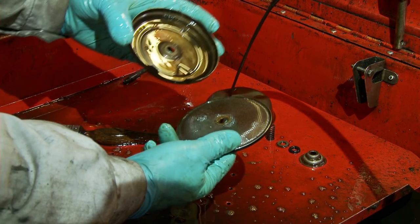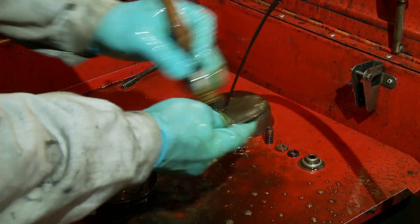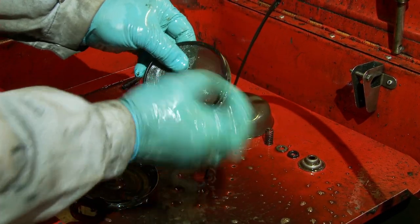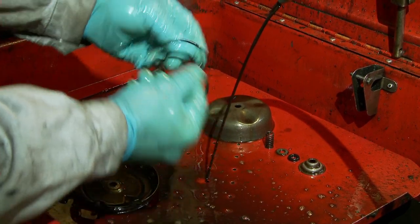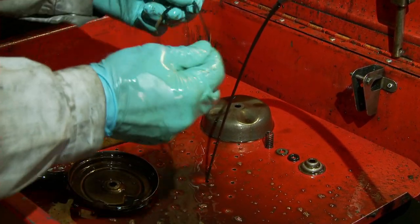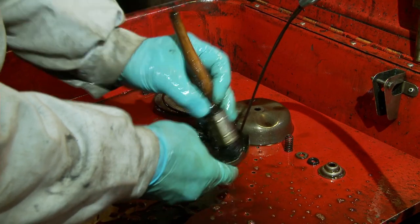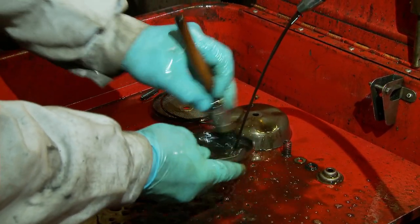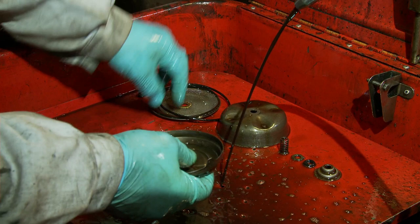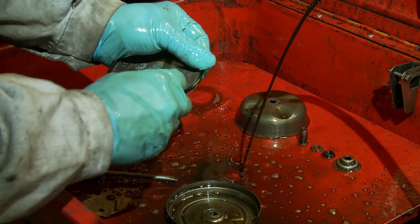In here, any crud in the oil should catch on this gauze filter first before it goes through the main filter — that's why it's there. This one is quite clear, which is fine. The other important thing is it has an O-ring on the outside. This O-ring has to be nice and flexible — I replaced this one last year so it's perfectly serviceable. When they go hard and come off in bits, that is not good because it's a vital sealing part. Clean the rest of the parts and make sure there are no bits of grit. Then it's just reassembly, which in the best traditions is the reverse of the disassembly process.